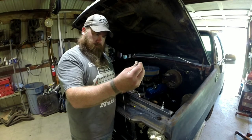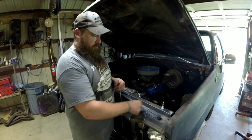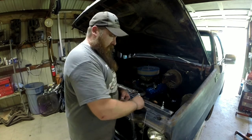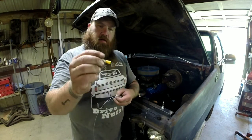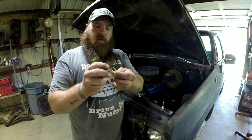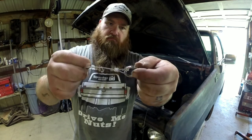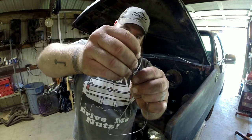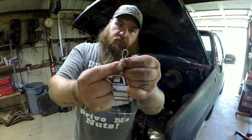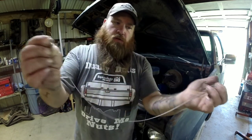I'll show you what I'm doing with these cables. You want to put them on a cable so that when you pull the pins out you don't have to keep track of them. Just pass it to one of the bolts here on the radiator support. All I did was take some wire — you can get it from a hardware store or Walmart, just picture-hanging wire — and took a wire terminal, pulled the insulation off, cut the end off, then looped it around and crimped it. Make a loop on the other end, make it big enough for your screw to go through, and crimp it. You'll have a fancy set of high-speed racing wires for your hood pins.